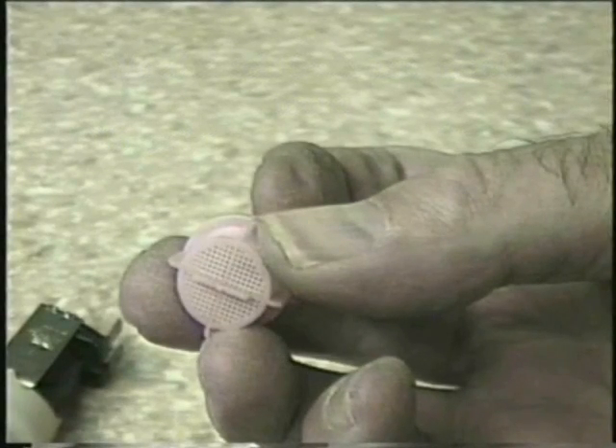If you have had cause to remove the filter, make sure it's clean before replacing it. Because if a bit of grit gets caught between the diaphragm and the valve body it would allow a trickle of water to pass when the valve was closed, and you would find clear water in the drum in the morning. In this situation it's not advisable to dismantle the valve and try cleaning it out, because they never really work satisfactorily afterwards anyway. Just replace the valve.